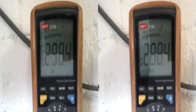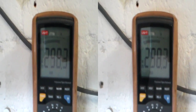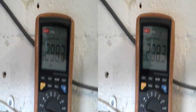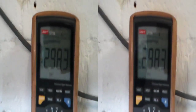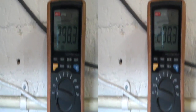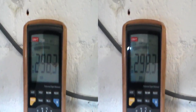Average voltage — this is measuring the average voltage — is now currently 298, and that's gone up because originally it was about 297. So it is charging the battery, not very much, but it's charging it. We don't want it to charge it very much simply because the battery is actually charged. We don't really want to transfer much charge into it right now because we'll damage it. But it does prove that even on a fully charged battery — well, it won't be fully charged, it will be about 60% charged — because when they come out of a Prius, the Prius tries to maintain it at 60%. So it is actually transferring charge into the battery, which is the point of a charger.